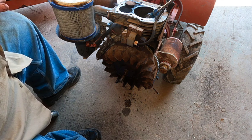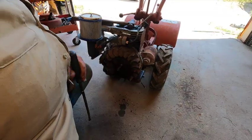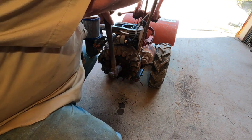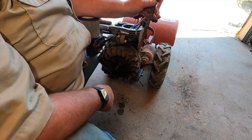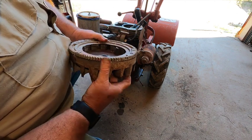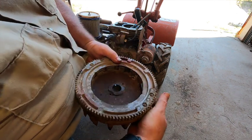Since I've already got another engine for this tiller - it's actually a generator I bought from a yard sale for five bucks that isn't locked up. I put my pry bar behind here, put a little bit of pressure on it and pulled on the flywheel. I just gave it a really small tap and she popped right loose. I wouldn't go beating the crap out of it or you'd flare the shaft up. Look at this - a weight, a magnet inside the flywheel that's come loose!